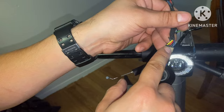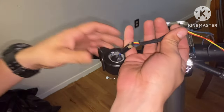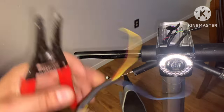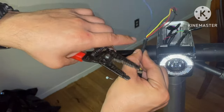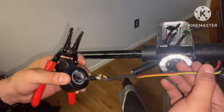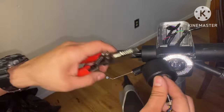You see you have four wires here: yellow, red, black, and blue. Go ahead and take this black tape off. The wires that are separate we're not going to use — right up top you have the wires you need: blue, black, yellow, and red. Since you already have this off, let's get rid of this blue wire because it's an extra wire and not needed — clip that off so you won't get confused. We're only left with three wires: red is your positive, black is your negative, and yellow is your signal wire. Now let's put this back in place.